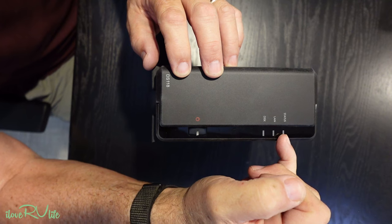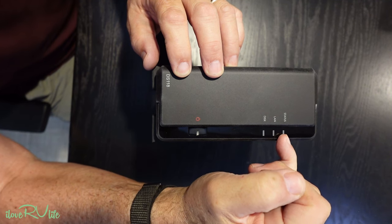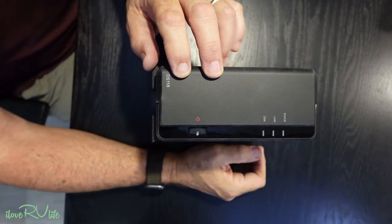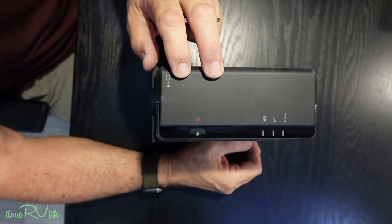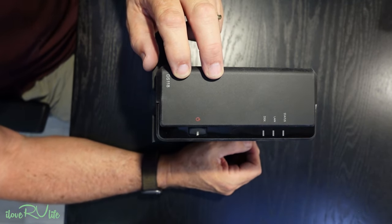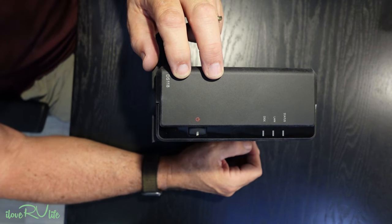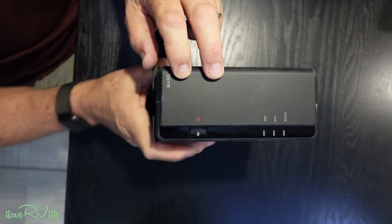And then the status says whether it is in active use, green, or it can go yellow if you set this up for the hard drive to go to sleep. I'm going to set mine up for the hard drive to shut off after an hour. I think default is 20 minutes. And that's just for power consumption. But it's a very, very simple unit.